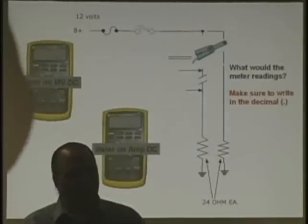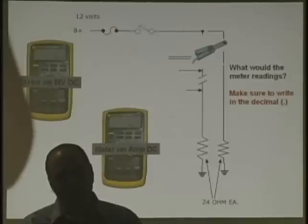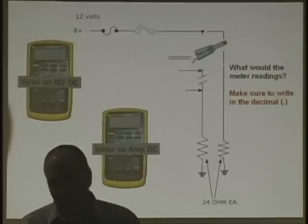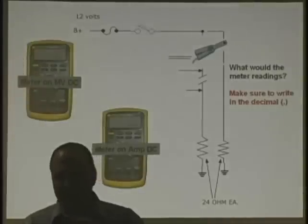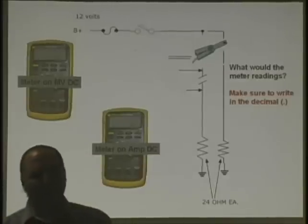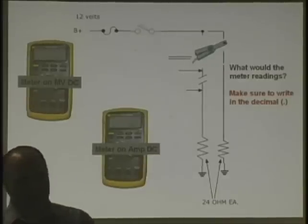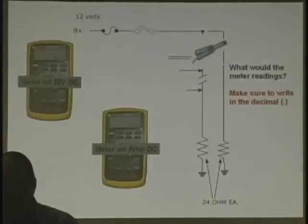You got one leg coming off this injector. You're going to use your meter in series with this. We're going to hook the black wire that's on the floor to this black lead. Does everyone understand that? Black wire on the floor to the black pigtail lead. Okay, so black lead on the floor, black lead here. Now, meter. And don't hook anything up yet until...